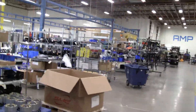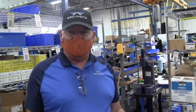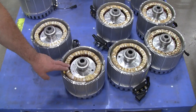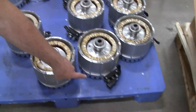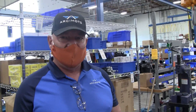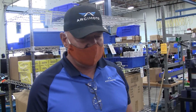If you haven't seen an electric motor before — a BMW engine block has 350 components that make up that working motor. Arcimoto has one on the left, one on the right. We're talking about a casing, a set of field windings, and simple bearings right here. A couple of high-voltage connectors. We do a gearbox in the middle — front wheel drive, left and right — that way we can do some traction control through software.